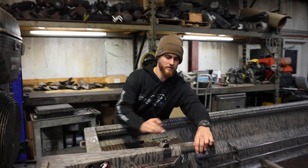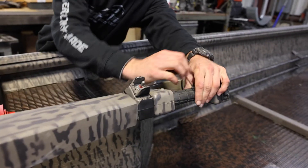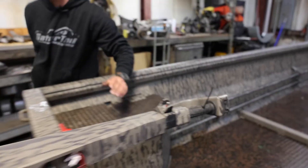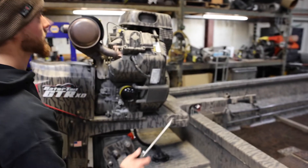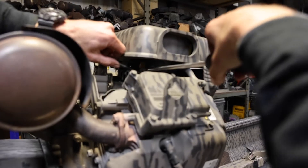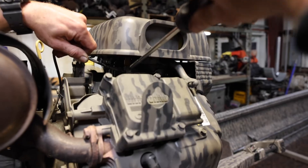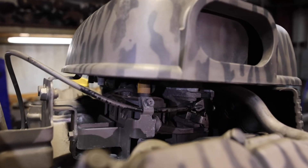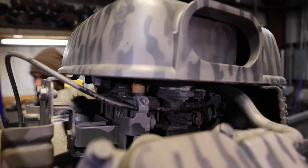You don't want to clamp it all the way down because you've got to reset the throttle. So come to the throttle lever, squeeze it to full throttle, and put a cable tie there wide open. Then come back to the back, loosen the cable to where you can slide, pull to wide open throttle, and tighten. Then just cut the cable tie off and your throttle cable is lubed.